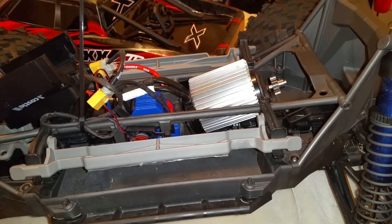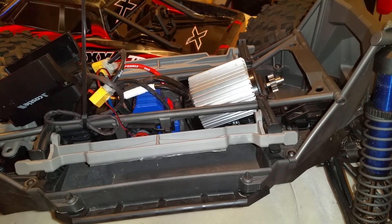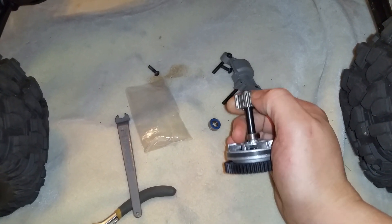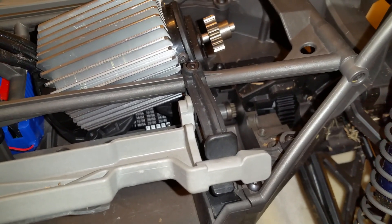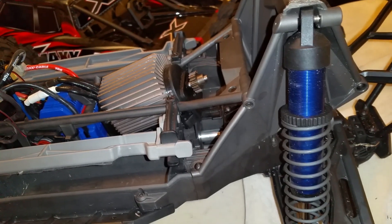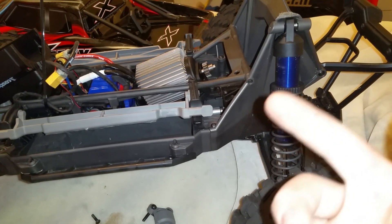For example, using an 18/54 combination — that's a 3-to-1 ratio, so for every 3 spins of the motor pinion, the spur spins once. That then spins this one time, which spins the secondary gear down there — I'd estimate that's more like a 4-to-1. So you're up to about a 7, 8, or 9-to-1 ratio. Then you add the differentials, and you're possibly up to a 15 or 16-to-1 ratio, meaning for every spin of the tire the motor is probably spinning about 30 to 40 times.